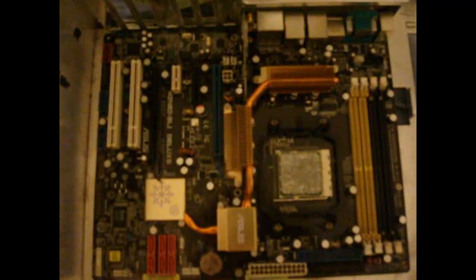I got the motherboard that's slightly secured. I still have all these screws to put in still. The reason I didn't put them in yet is because I still want to leave it kind of loose, just in case I need to move it for cable management. I basically have a few select screws inserted and they're not tightened all the way, just in case I need to lift it or put some cables underneath. I'll leave it like that for the time being, and finally when I get some stuff in before I get the video card in, I'll go ahead and secure this down.